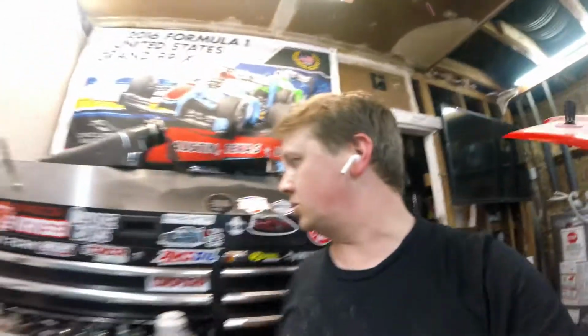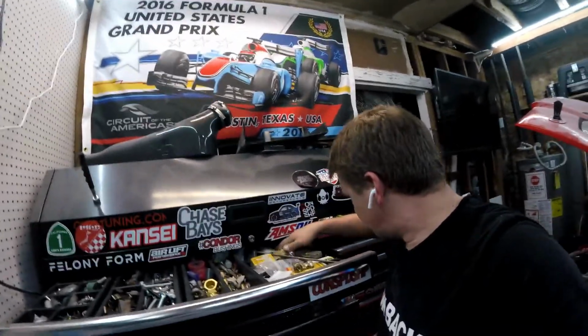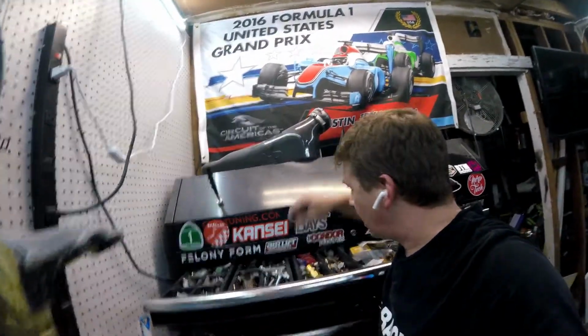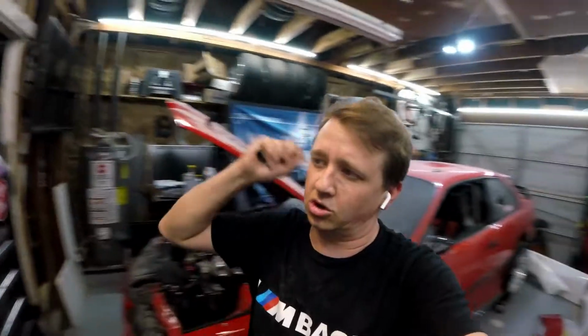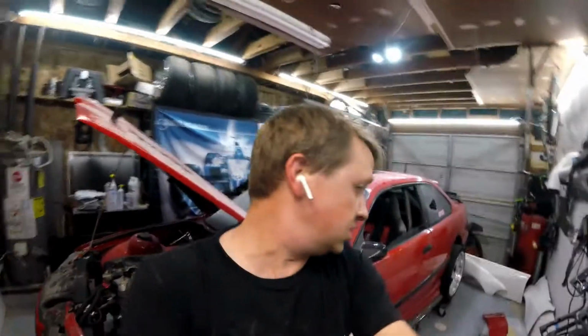And then the one thing we will do is, I have it somewhere up in here. There's a fitting somewhere for this to plug in. I don't know where it is. It's plastic. It's here somewhere. To plug that into the ICV so that you can run the ICV to the intake manifold, so you get stuff that's after the MAF type situation, so all the vacuum lines will work. But we have reached a stopping point for tonight. We need some vacuum hoses, we need some coolant hoses, and I'm not going to start suspension or anything tonight.